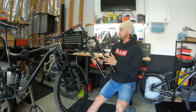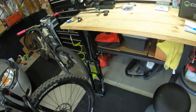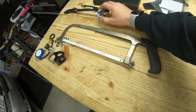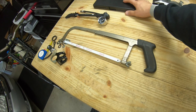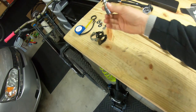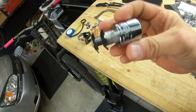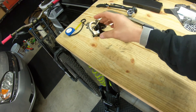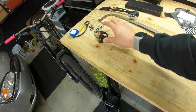We'll have to get some spacers for that. For this job you're gonna need a hacksaw — we're gonna do it my way. You're gonna need an air pump for your air pressures, a gauge to measure, some spacers — gotta figure out what I can use — a homemade star nut impactor (I'll show you how I did that when I get to it), and an old stem I'm gonna use to cut the steerer. We're gonna do this the hacky Sherman way.